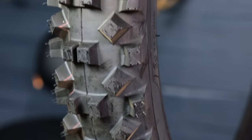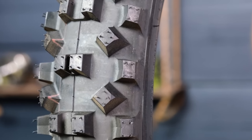Okay. I guess I have only run this style of tire for years now. Compound doesn't matter that much for forward stopping, but if you go with the bigger block desert front tires, if you're comparing an ADV tire or a heavy desert tire to these, they will not stop you. You need these thin little treads. They're needly blocks, right? The bigger blocks just don't dig. They slide across the top of the dirt and you'll have a lot more front washouts.